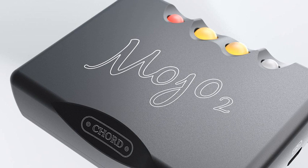So I guess I'm kind of jumping ahead of myself, really, because one of the modes that we've got with it is an intelligent desktop mode. So when you plug the battery in and charge it up and it's running, once the battery is fully charged, it actually gets physically disconnected. Okay. So the benefit of that is you can run it for 3 or 4 years, and the thing has only been charged once, and the battery is actually physically disconnected. So you don't get any battery wearing out.